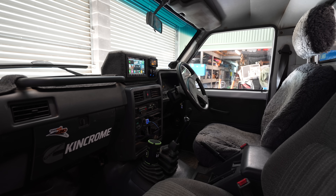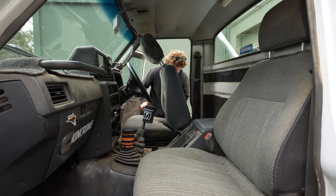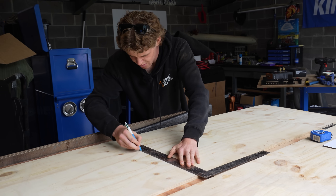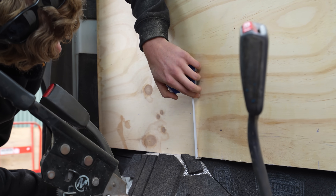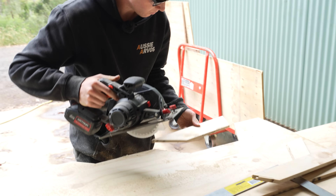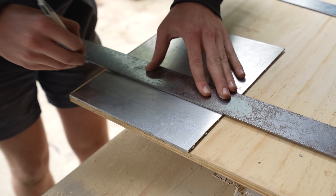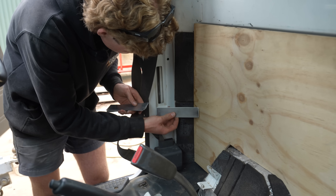The SmartShunt is going to be mounted in the cab — I wanted to keep it out of the weather and easy to access, hopefully on a 12-volt panel behind the seat. I wanted this panel to cover the whole width of the cab, and luckily there's no shortage of plywood in our shed, so finding something sturdy but light was no issue. I had to notch the bottom of the panel to fit the profile of the floor, which was easily done with a few rough measurements. We're also making up some brackets using some leftover aluminium. Because the panel is sitting on the floor of the cab, these brackets only need to hold it upright and do not need to support its weight.